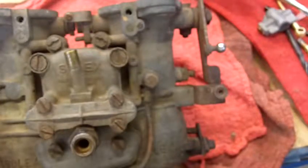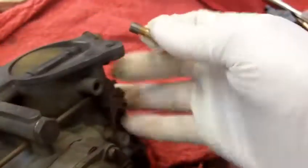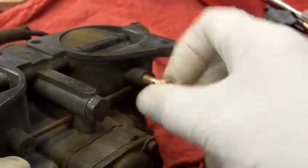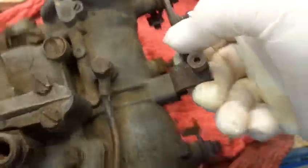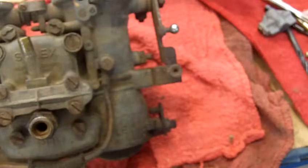That's why I was saying it's not an insurmountable problem. It's one that I fix regularly because the hollow bolt happens to be the same hollow bolt and the same thread pitch as the drain for the first barrel on the Solex. It's very common to repair the threads in these — they pull out regularly. It can be fixed, but you will have to send me the carburetors and it's going to take a couple, three hours of labor. I hope this explains. If you have any questions, please ask. Thanks.